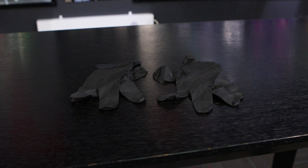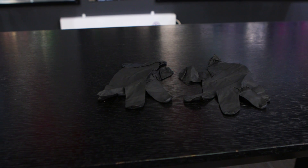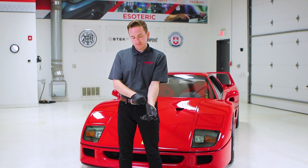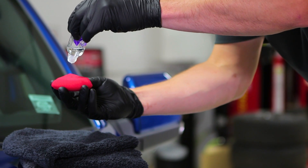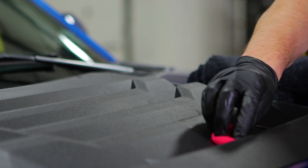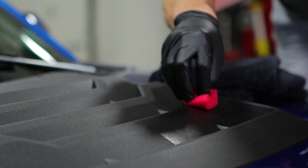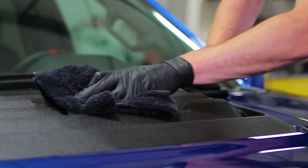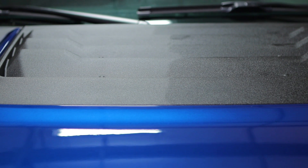As part of the application process, we recommend that you use rubber gloves for skin protection because you don't want the trim to get all over your fingers during the application process. Just a couple of drops on the applicator, work it into the surface thoroughly, and then let it set for three or four minutes. Then, once that's done, you can come back with a microfiber towel and just lightly buff off all the residue, then make sure it stays dry for at least 24 hours.